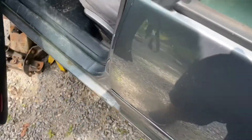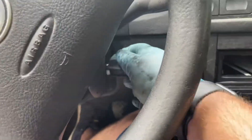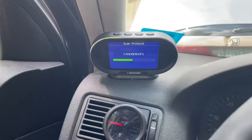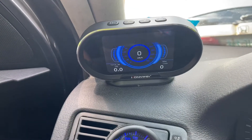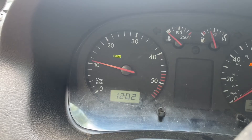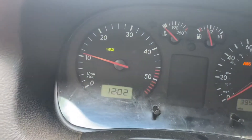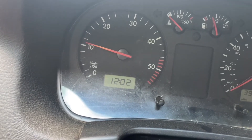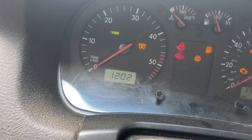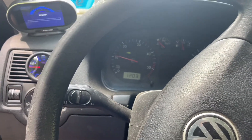Now let's see if this piece starts. Clutch is in, key in — 12.1 volts but should be enough to start. Cross your fingers... it started right up! 13.9 volts, we're charging, sitting at 1100 RPMs. One more start — listen to this baby start now. Starts way faster too — that starter sounds like it's really putting out some juice now.